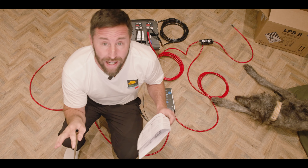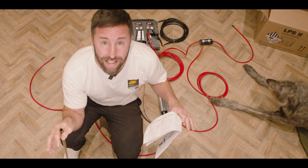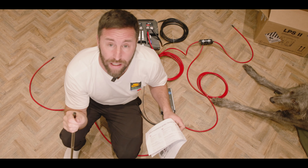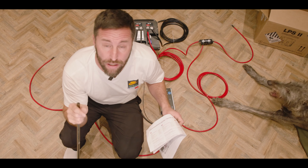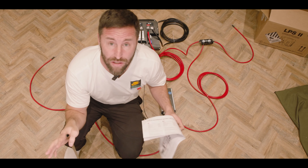To explain common ground because it can catch people out: common ground on a vehicle is anywhere on the chassis where there's good continuity — i.e., good ability for the electricity to run through. Sometimes you'll have common lashing points on a vehicle that you can use, but you can make your own by simply drilling a hole where there's good continuity on the actual framework or body of the vehicle, sanding off a bit of the paint, and utilizing a spring washer and a nut and bolt. Then you can put your shoe connector to that bit on the van. You'll find videos online that explain that much better than me.